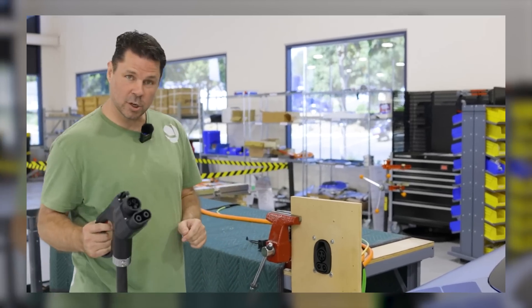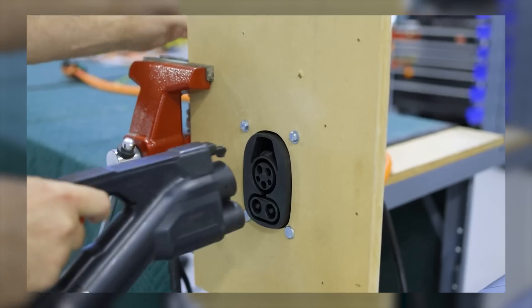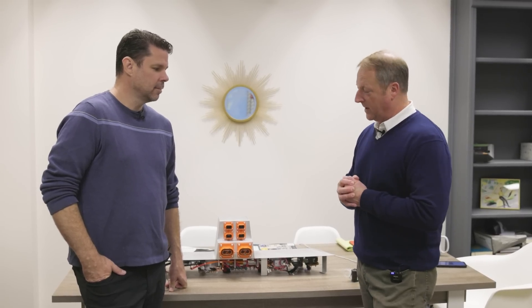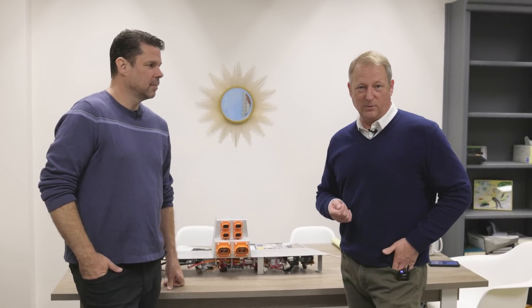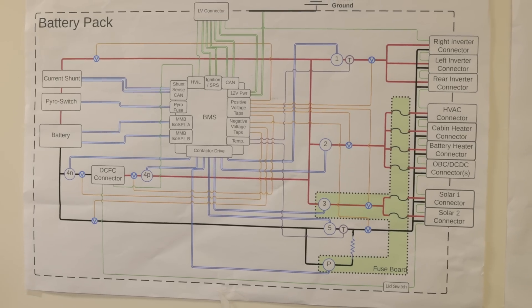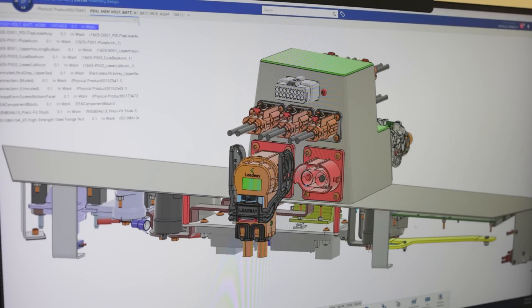You may recall from Chris's campaign earlier this year to lobby Tesla to release their NACS plug for public use. Before that was done, the only option Aptera had was the SAE combo plug — a very big plug, and a very difficult problem to package on the vehicle. That's why we always wanted a Tesla plug. Because we didn't have line of sight for that, and because we didn't want to package that big combo connector, we paused the development on DC fast charging.